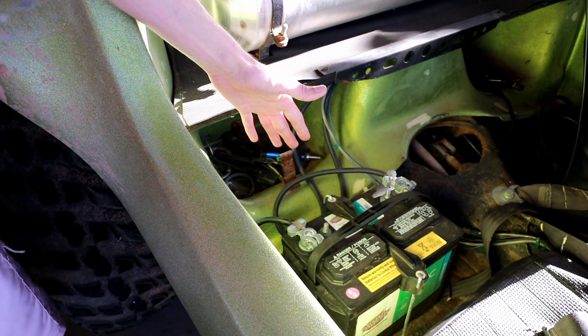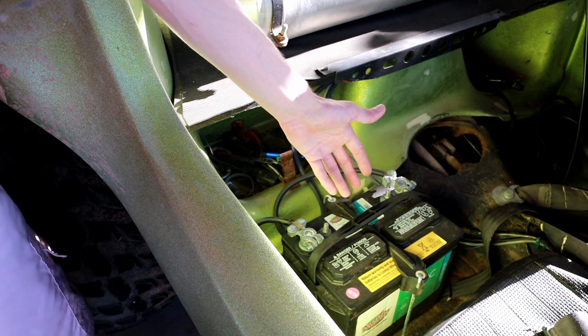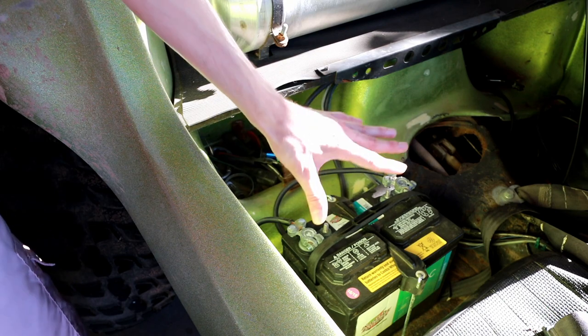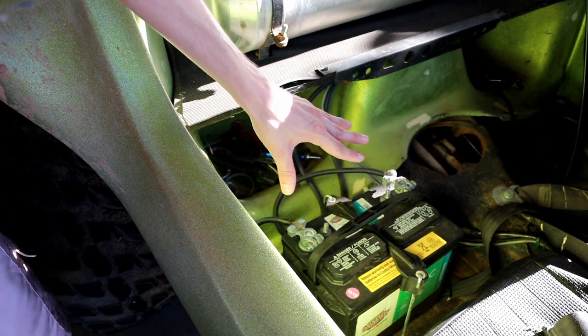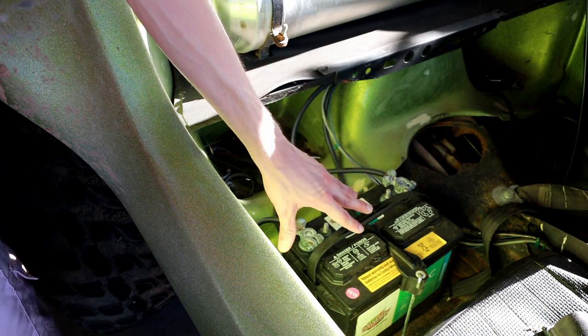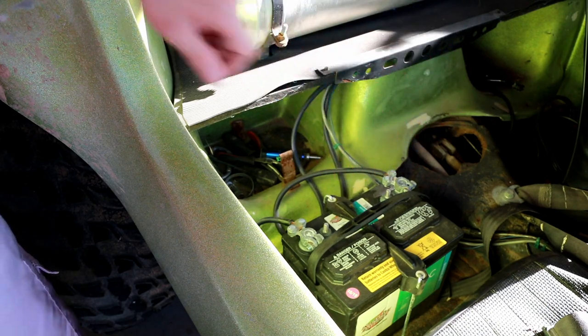At that high charging voltage, the hydrogen and oxygen in the water get broken off into H2 and O2 gas, which can then vent out the top of the battery, leading to depletion of the electrolyte over time. So periodically, I will want to be checking that acid level to make sure that there's sufficient water in the battery and adding some distilled water to the cells as needed.